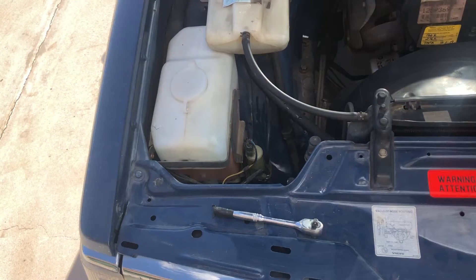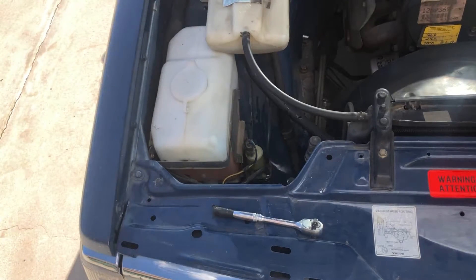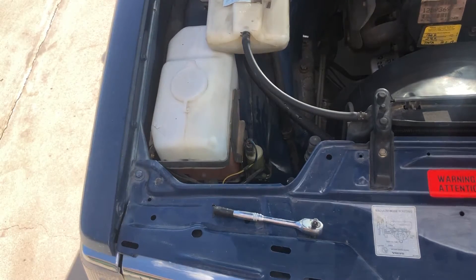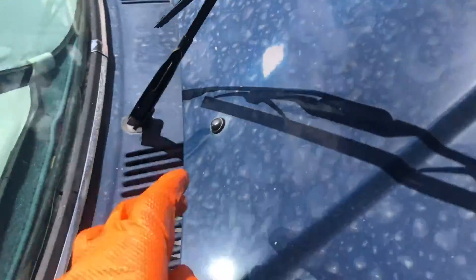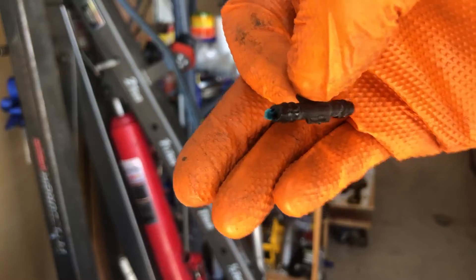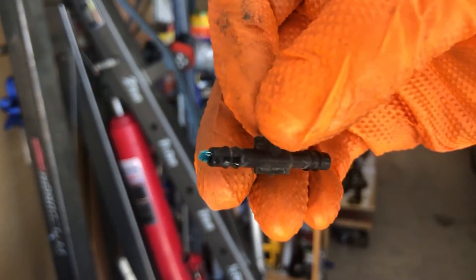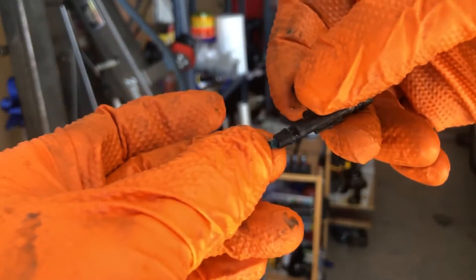The next thing for me is to continue cleaning those lines — they're a lot dirtier than I anticipated. Worst case for the front, you can just replace the windshield wiper sprayer nozzles; those can be a little tricky because everything presses in from the inside, but needle nose pliers pinching from either end will get them to pop out. Debris inside unions and old washer lines that haven't been used in a while will be all gummed up.